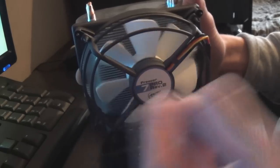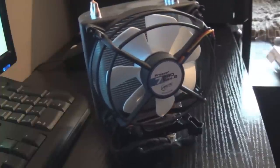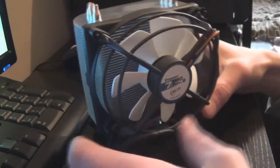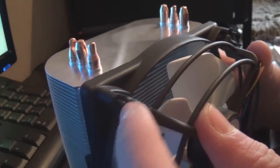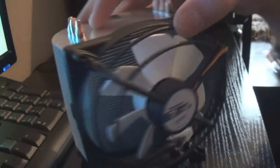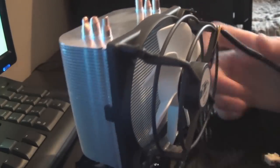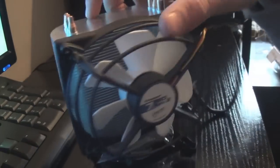There's a set of white blades — I think this is Arctic Cooling's flower design fan, where the blade orientation helps increase airflow. It's an open-frame type so the frame is open. Here you can see the rubber grommets that hold the fan to the frame — those are good because they help stop vibrations from the motor going back onto the heat sink and through to the computer, which causes noise. The Zalman cooler in my computer doesn't have anything like that and you can actually feel it vibrate back.